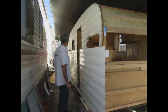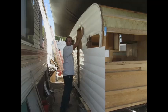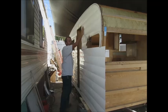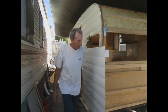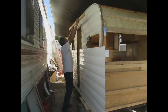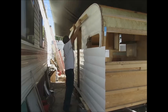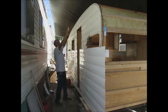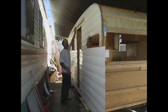If you're doing a complete reskin, get your top cut and get it in place. Don't cut out the door until everything's in place because if you do, you'll only have a little amount of skin up here and it's going to want to kink on you. Another thing you can do with your top piece is take a long half-inch or three-quarter-inch stick and fasten it to the skin to hold it all rigid — maybe a 10-foot piece — so that when you're moving the skin around it won't kink. Get a couple of staples or clamps in places around the curbing just to hang it, because it's going to want to curl on you because of the brakes.